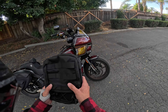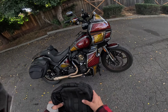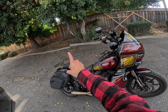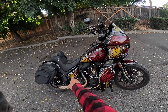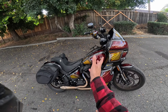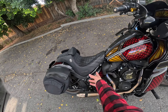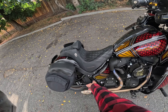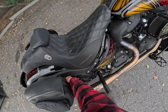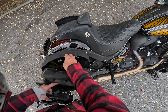You could put the amp in different parts of the bike. If you have saddlebags, you could put it in there. You could route the wire from the battery to the amp and then to your speakers — that's how you'll have to route it. You have to connect to your battery fuse, and then route that wire underneath your fender and down into here. So you'll have your amp in your saddlebag at all times.